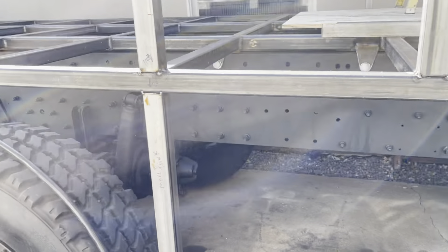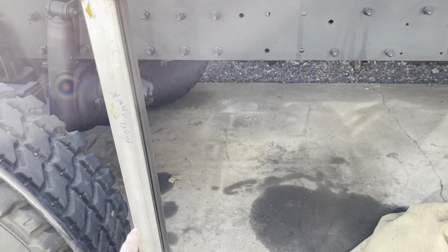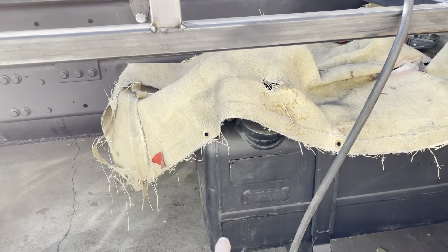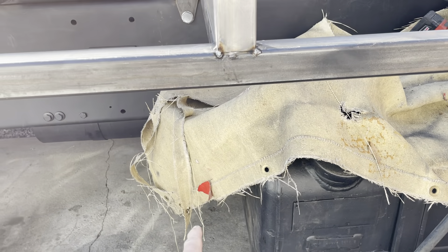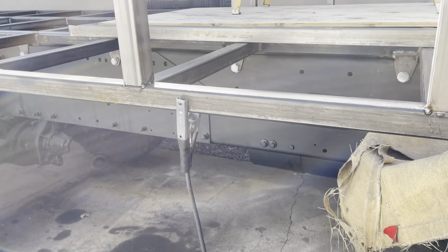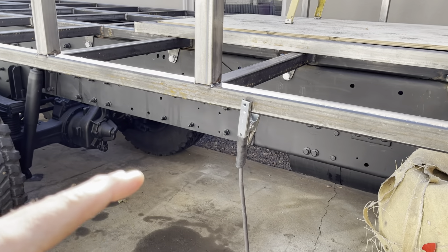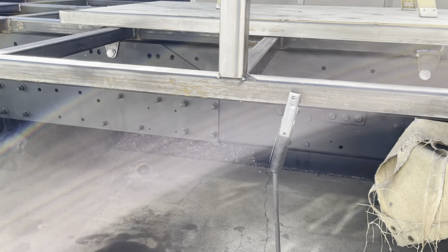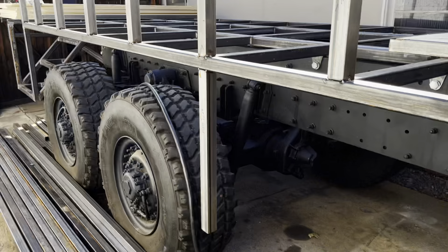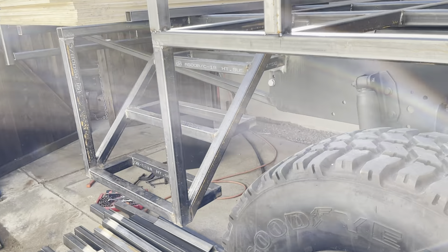I don't think I'm going to stay at the 28-inch marker — it'll probably be more like 20 inches. I'll move it over here; it has to be 28 to cover the fuel tank, then I'll probably come back a little bit and maybe do an angle for break-over. I don't think I'll be out wheeling this thing crazy, but if I need a little more break-over — that's the angle between your wheels — you have approach, departure, and then break-over. I'm a little worried about that, although my rear stairs sit down at the 28-inch level, which would be more of a drop-off than a break-over.